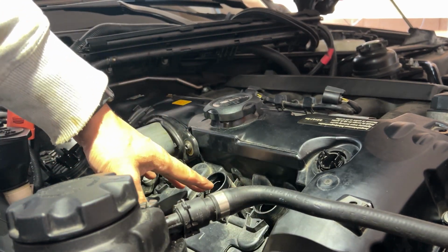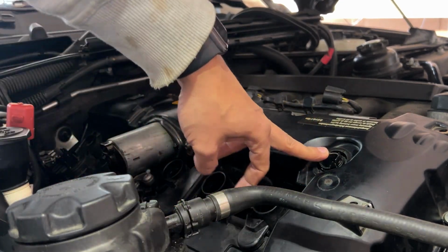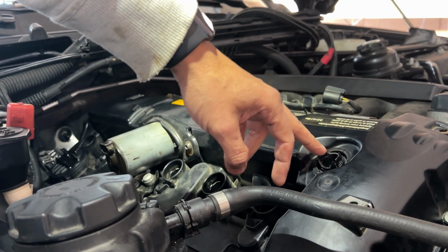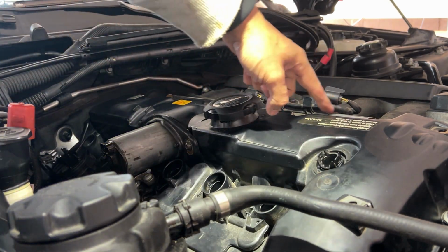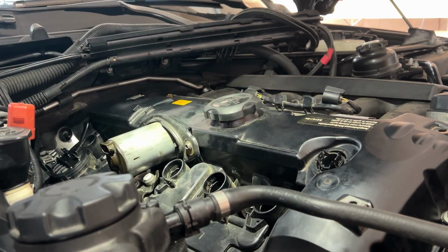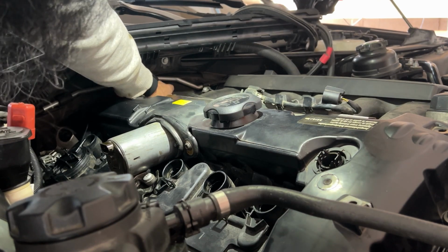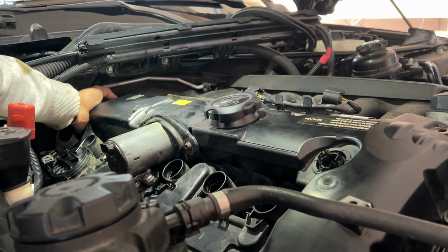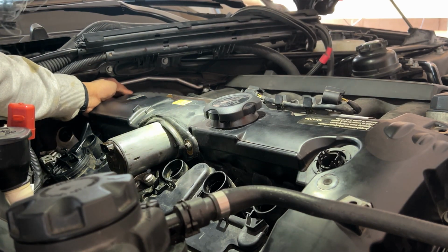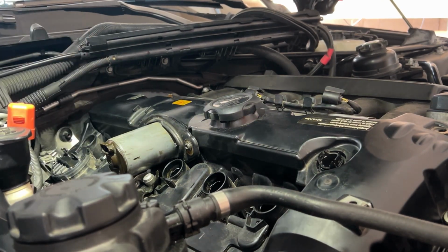Put back all the coils in there, then connect the coils and the eccentric shaft sensor connection here, and once the coils are back in, the connections there. Then connect all the fuel injector connections back there. Don't forget this hose, which we removed earlier. I'm just going to connect it back because my screws are tight. I'll just push it in. Okay, so it's in. That was the one thing back in there.